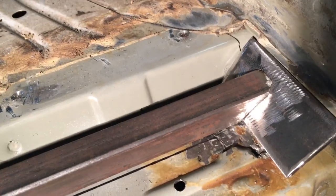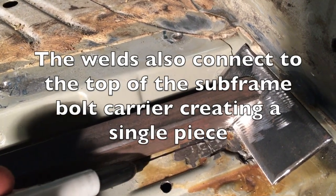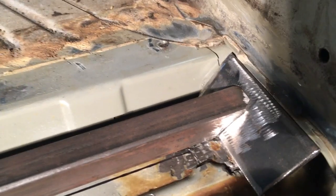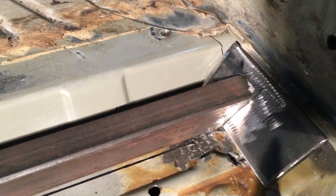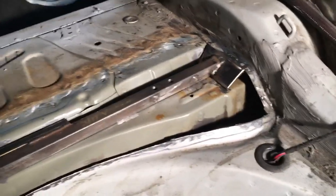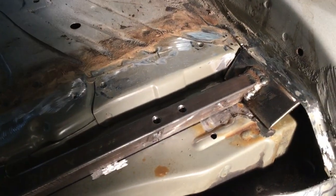Test fit going on here for the upper rear mount. We're going to weld all the way along here, right across the top of the internal mount, and across the top here as well — which will basically give us an L across the bolt where the subframe comes in. Then we weld this right to the side frame, nice and tight. When the panel goes back on, it'll create double triangles and really stiffen up this point. This is just a layout showing where we're going. We put this extra base in, laid in nice and neatly — fits against the front, fits over here nice and tight. You can see the screw holes — we tapped those, and we'll figure out what that's for in a bit.